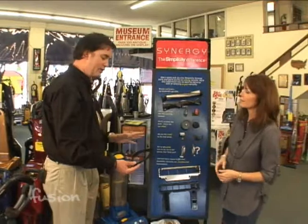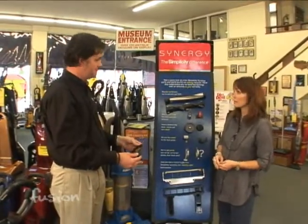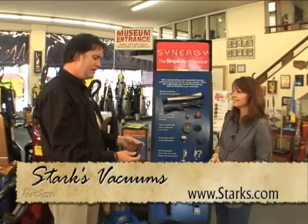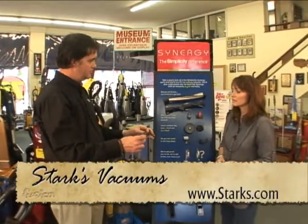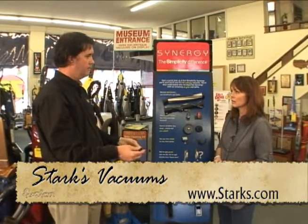So don't wait until it breaks. Belts should be changed about three times a year. Three times a year? Yes. That seems like a lot. Yeah, even if you're not using the machine they're pulled so tight they just stretch and they lose their strength pretty quickly.